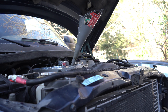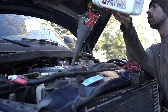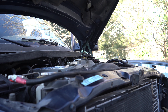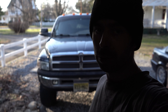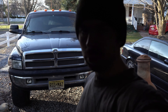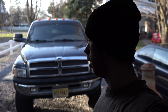I don't know how this turned into a how-to oil change, but always make sure the O-ring comes off with your old filter. I'm gonna prime this filter — kind of wondering what I'm gonna call this video now. Filter's back in, tighten everything down, then we'll fill it up. It takes about 11 to 12 quarts. It's not the right funnel but it's gonna have to work — slim pickings here.